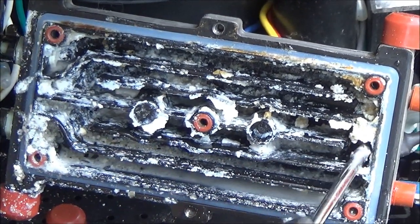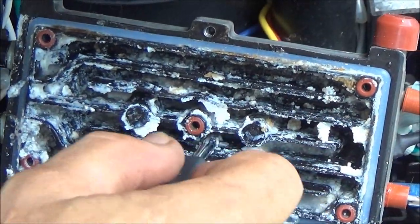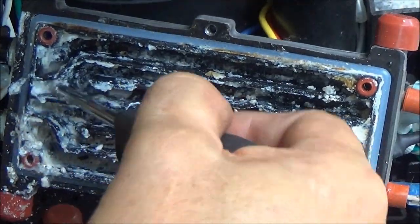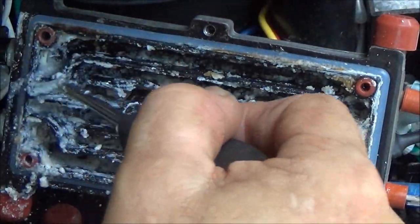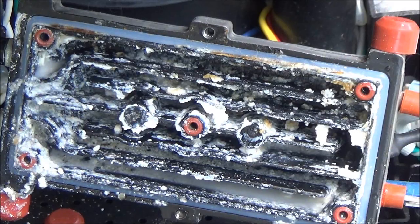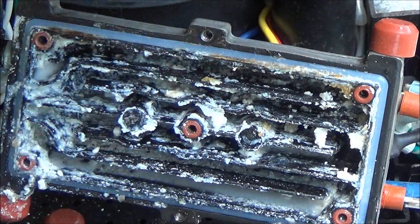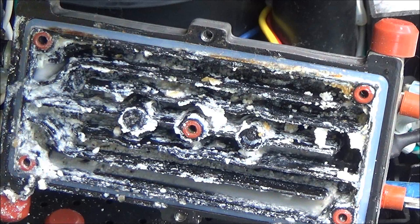What I'm going to do is get a smaller screwdriver and a Q-tip and get all this cleaned out. I'm going to take these hoses off and make sure these inlets and outlets aren't clogged. I'm going to venture to say it is the clog, because the water has to run through this heater to go everywhere else. Down here in Florida we've got a lot of hard water, so that's what caused this buildup. When you turn the heater on, it heats your water up and it has to run through here before it runs anywhere else.